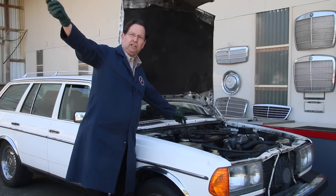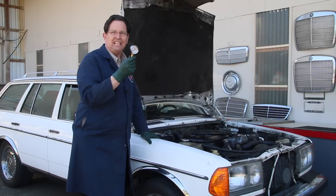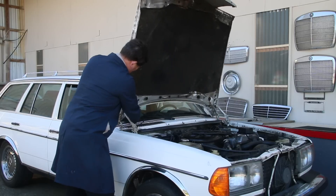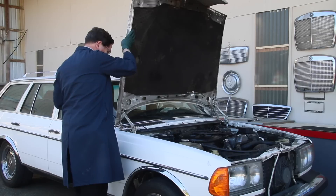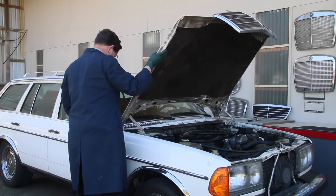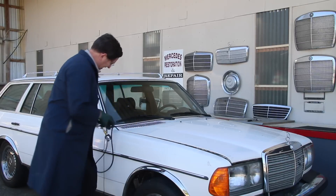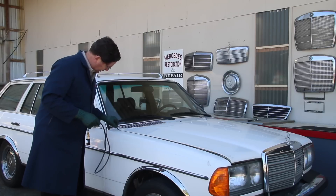I've got a long hose here. We've hooked it up to the fitting on the intake manifold. Now I'm going to route the gauge inside the car. The best place to route this hose is right up here in the corner - usually there's enough gap here, and if there isn't you may have to adjust the hood. I'm going to lower the hood down slowly and get this hose right in the corner. You don't want to be pinching off the hose or you won't get accurate readings on the turbocharger.